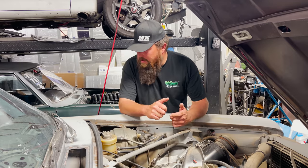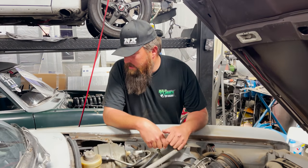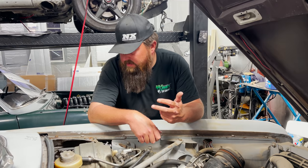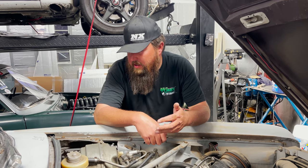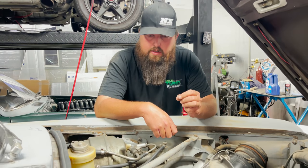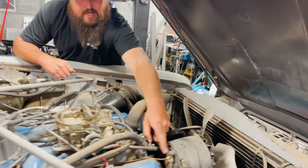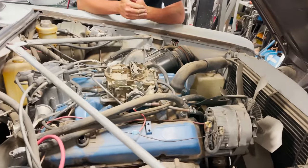Alex has been doing some numbering on the Googles — what'd you come up with? For the V0215 CKR: V is Flint, Michigan. 0215 is February 15th. And the CKR stated it was either '73 or '77, 350, 170 horsepower. The serialized number is up on the front. At least we're getting it figured out. Hopefully this engine does us good for at least a little bit.